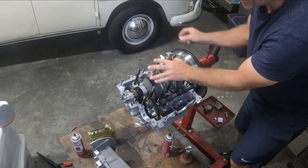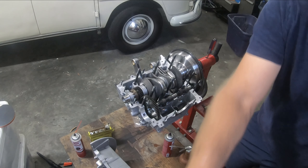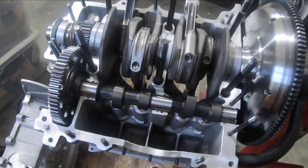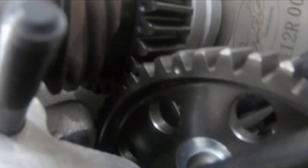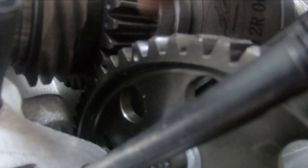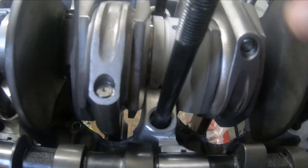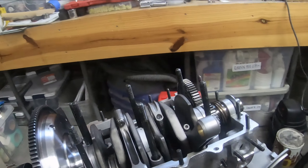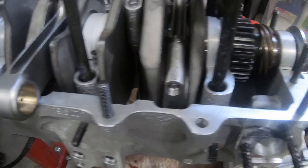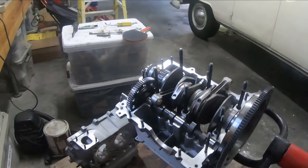Now I'm going to find out what hits — that's the question. Let's look at this real closely. I have my straight cut gears. If I look in there real close, you might be able to see the dots — here's the one dot, here's the two dots. What I'm looking for is clearance of these rods on the cam. My rods, the cam bearing, and then this one. I'm going to check how the clearance is and I'll turn it back on after. Let's start planning.